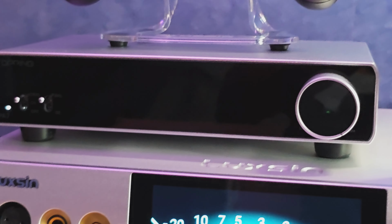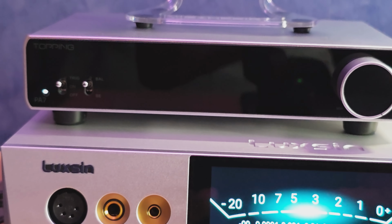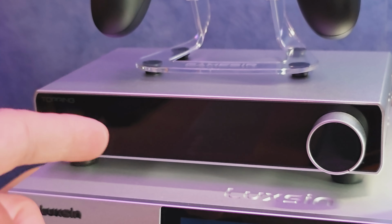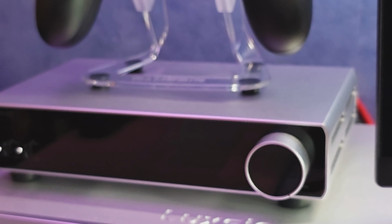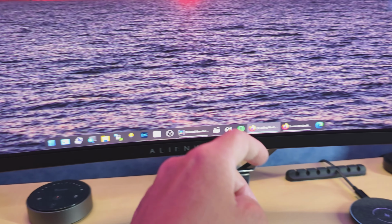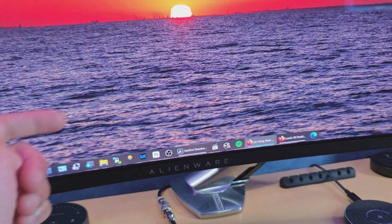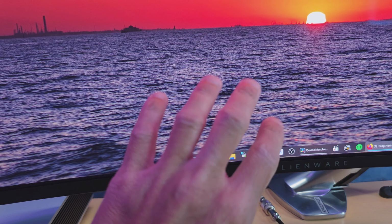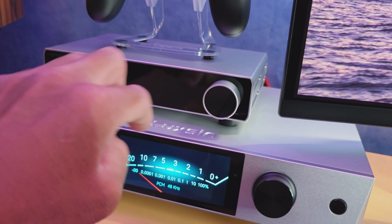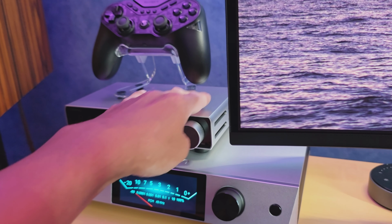Other quirks about it, the front panel here, this panel thing here, it's not glass, it's acrylic or perspex or whatever it is. It is a scratch magnet as well, so that I've already got some micro hairline scratches on it already from where I've been sort of installing it and faffing around. But if you touch it with your nail, that's a scratch that's going to show up on there. So similar to OLED or QD OLED front panel films, if you touch it with your nail, that's it, that's toast. That's a scratch, that's never going to go away. So do not touch these things with your nails, or try not to. Cleaning it, wipe it with a microfiber soft cloth. That's it really.